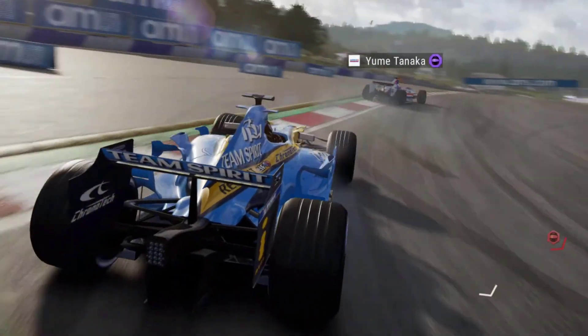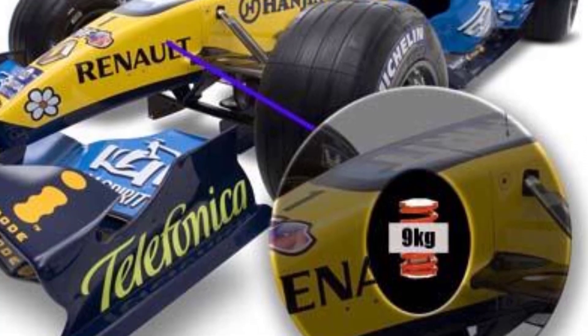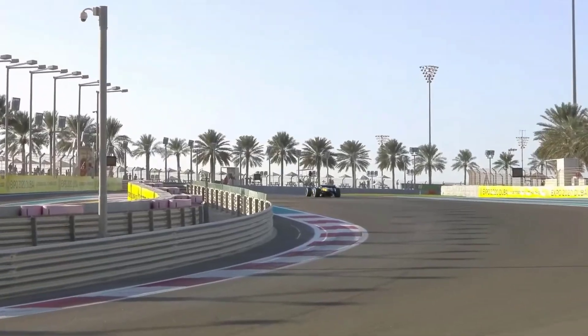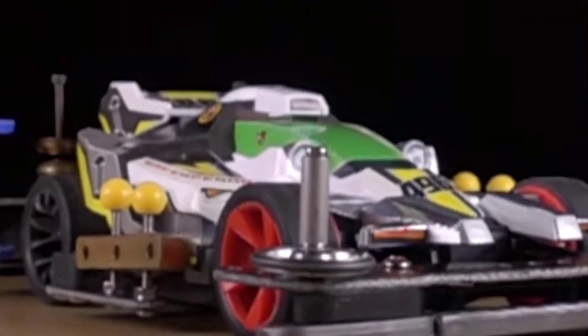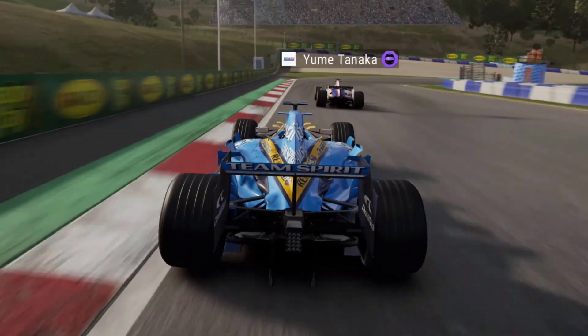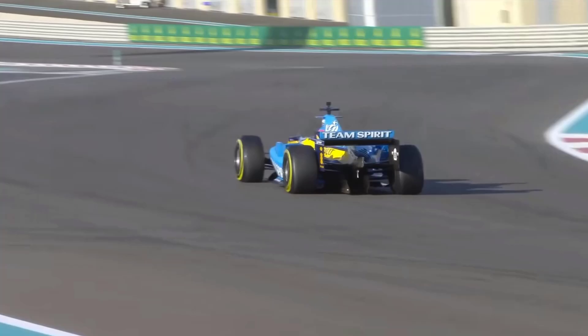This makes the car harder to drive and slightly slower than it would otherwise be. The mass damper is a device designed to even out those fluctuations and to stabilize ride height and downforce. This maintains front-end ride height and level of grip by pulling the nose down every time it passes over a curb or a bump in a corner. Because of that, the Renault R26 uses the tire contact patch much better and also benefits on the aero side as the front end of the car is less pitching and more stable.